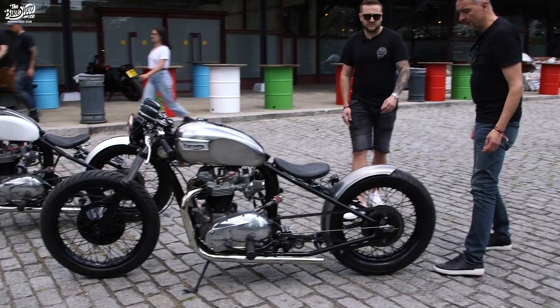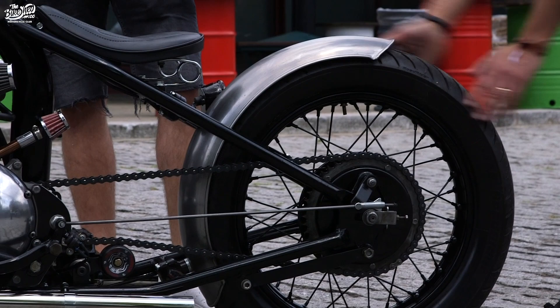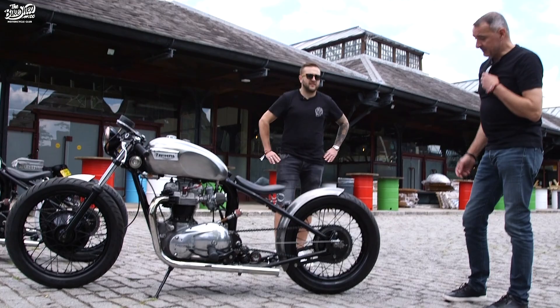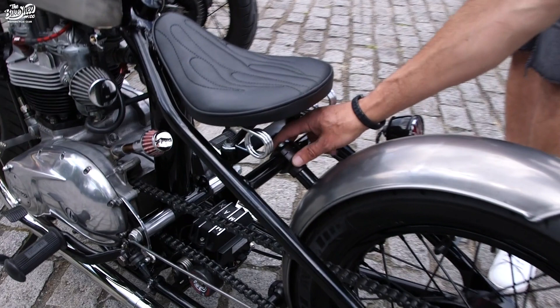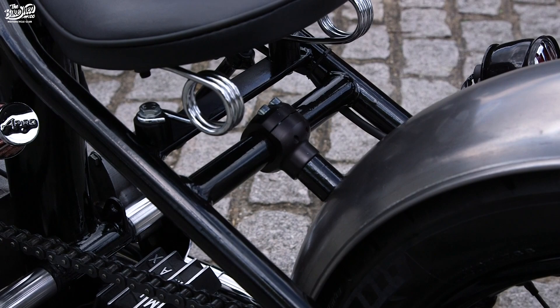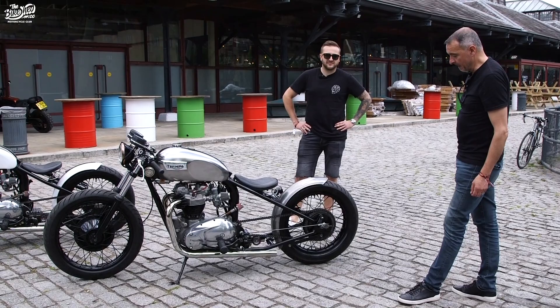Concluding on the design of the bike: things like the rear fenders — a lot of parts came from dealers' old stock. Both fenders came from Kempton Park Auto Jumble, bought as a pair. Polish them up. Lucky I did buy two at the time, because it helped with the copy exact. For the mountings, we used go-kart bobbins — they happen to be 28 millimetre, the right size. Gives adjustability into the rear fender and they're pretty robust and secure.